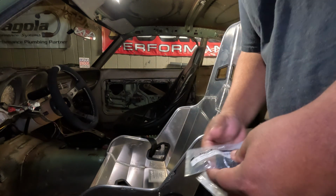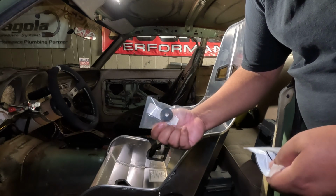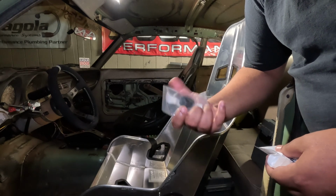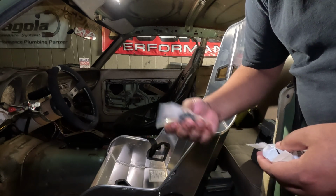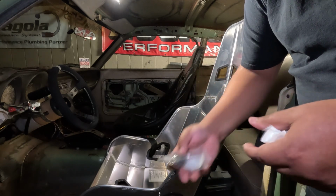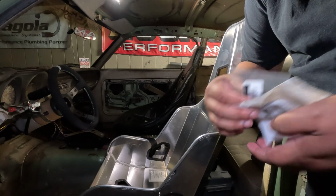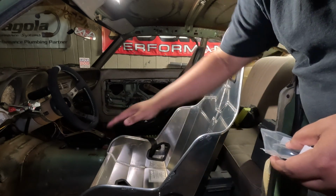And I'm going to achieve that goal with some spacers. Just some plastic. I guess they use these for sprint cars, and if they're good enough for those, they're probably good enough for this. They're just some really hard plastic spacers that you put under the seat. In this instance, I'm probably going to put a 1 inch on the rear and then stack a 1/2 inch and 1 1/4 in the front, just to have it tipped forward.